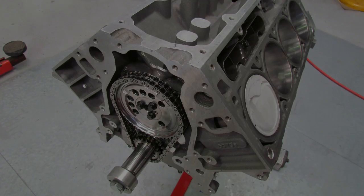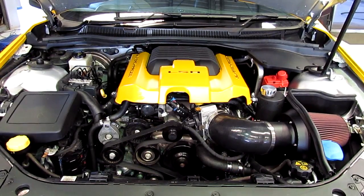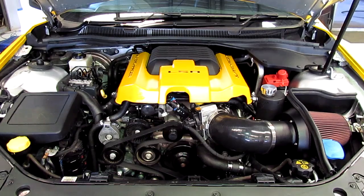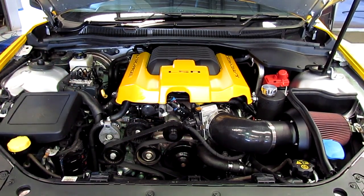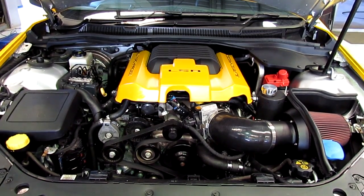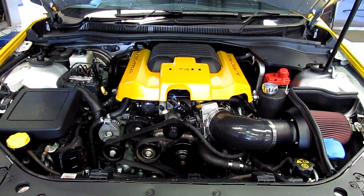We also stepped up the clutches in the torque converter and went to a slightly larger stall to deal with things. But it's back in that format at the moment. We've gone a tiny bit further on the supercharger. This one was done previous to us. It had the small top pulley. Not the most efficient way to get its 18%, and really not running quite the same boost as when you do 18% overdrive on the bottom because of the lack of drive up the top here.